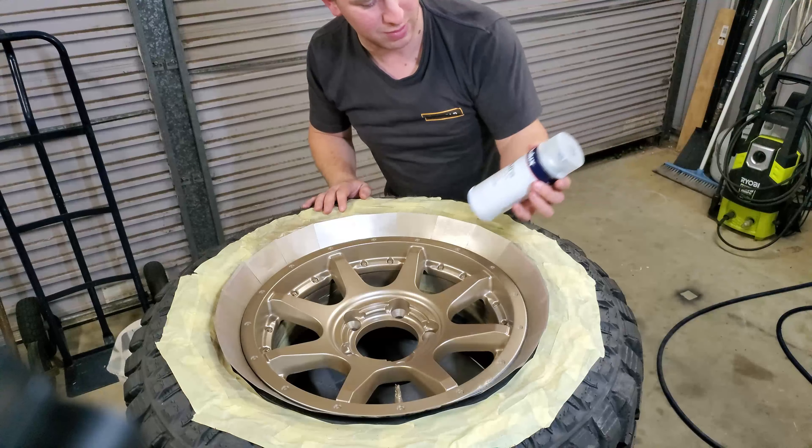Just soak for a second and then start to rub it off. There's where the masking tape was and a little bit of overspray from that side — not really too concerning. Now I'm going to mask it so that when I paint the inside area with black, I don't get any overspray onto the gold part of the rim. Just put a little bit of masking tape over the top and then go for it with light coats of black.